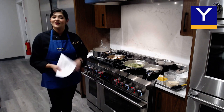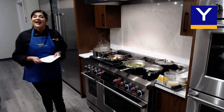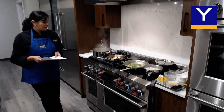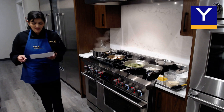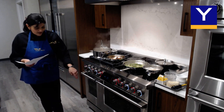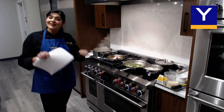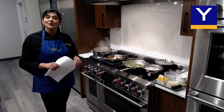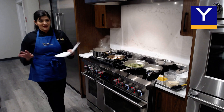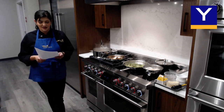In the larger oven, the telescopic rolling racks can hold up to 32 pounds and it comes with two rolling racks. The side rails in the larger oven are porcelain enameled, which means you can actually leave those in when you use the self-clean mode. However, stainless steel racks unfortunately cannot be left in — you would have to remove those if your oven came with stainless steel.